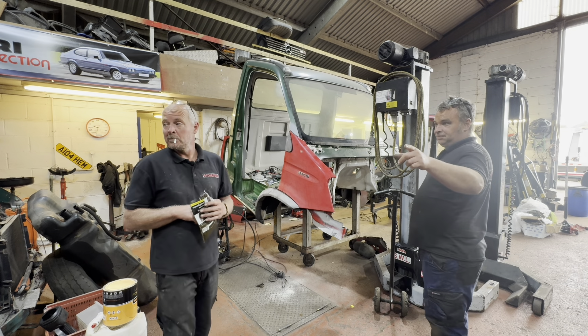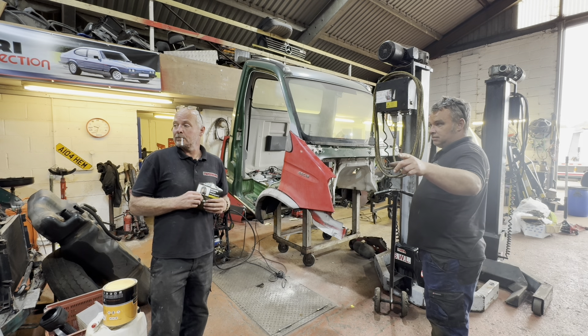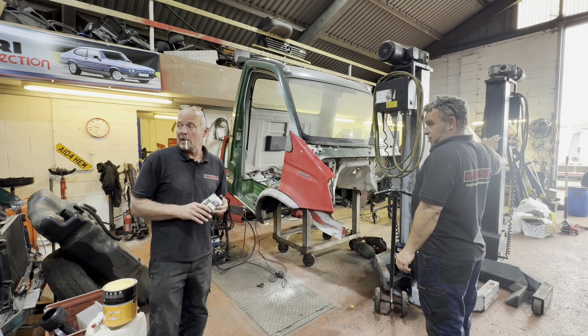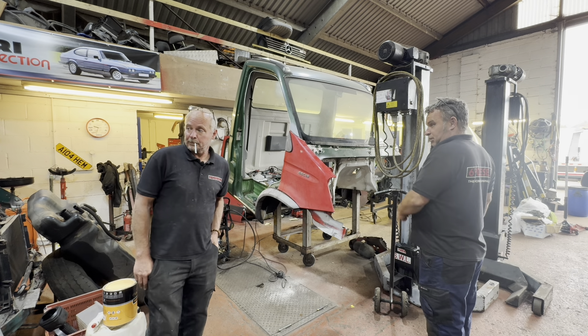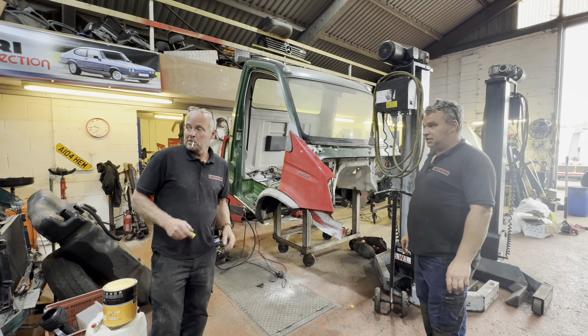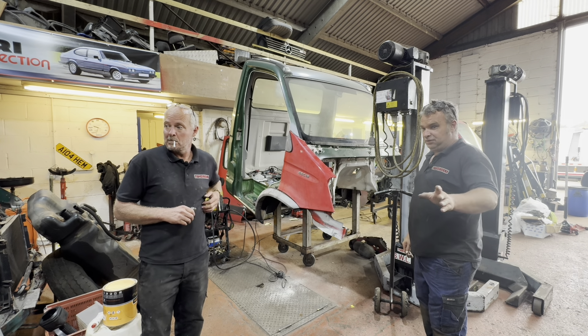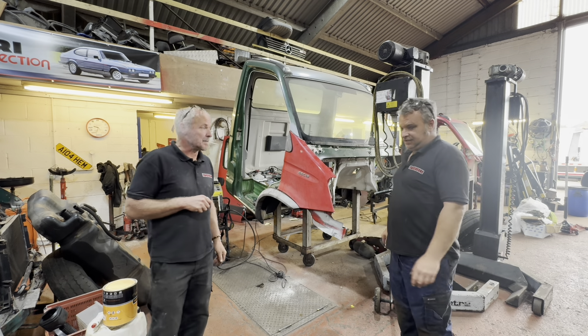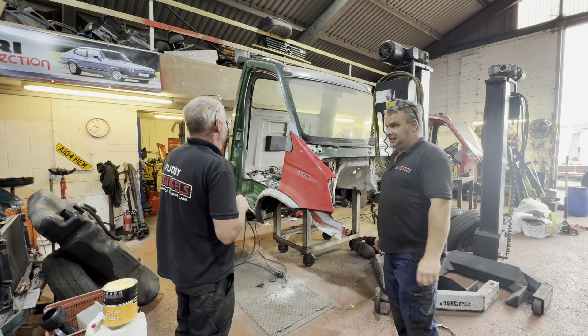Simon can have this back tonight. Then all we've got to do is beaver tail the chassis once we've got it moving, because we need to do some complicated measuring to adjust the body — cutting the back wedge out to make it properly fit the lorry. We'll show you all of that and explain why it needs doing. Right, let's crack on.